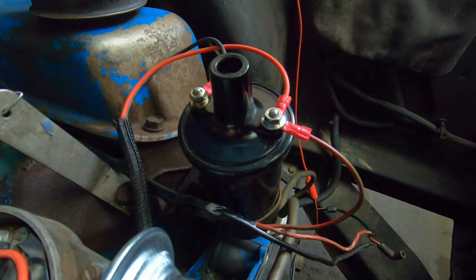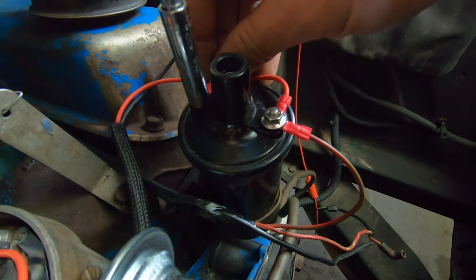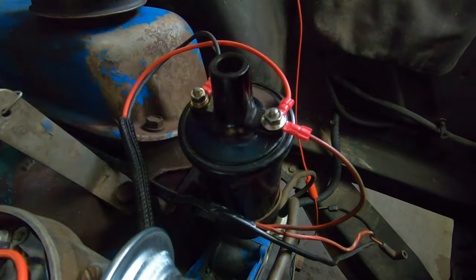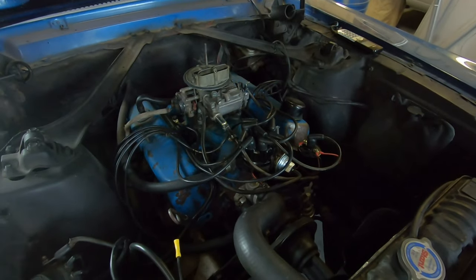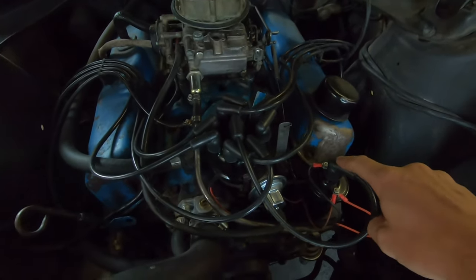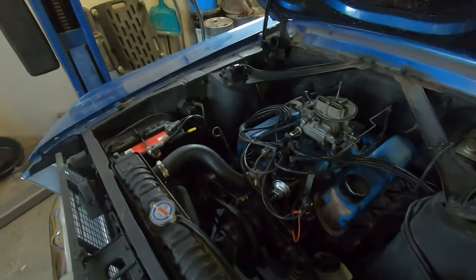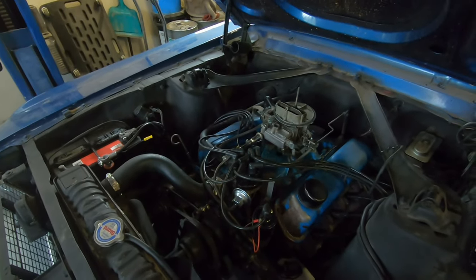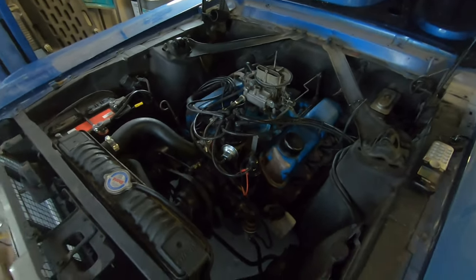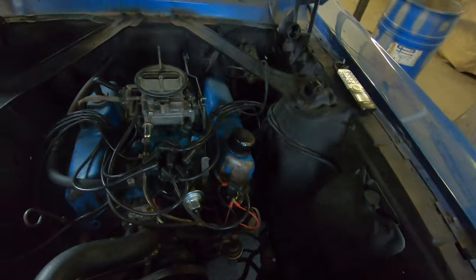I found that the nuts that came in the kit did not fit my specific coil, so I had to track down the right nuts — just watch out for that. If it doesn't spin on nice and smooth by hand, then it's wrong. I think we're ready to fire this up. Everything's installed, we've verified the resistance on the circuit including the coil is the correct amount and within specifications. On this particular car it's just a bolt-in, ready to go without any modifications. But you definitely want to take your time and make sure everything is good within the parameters as far as resistance goes.